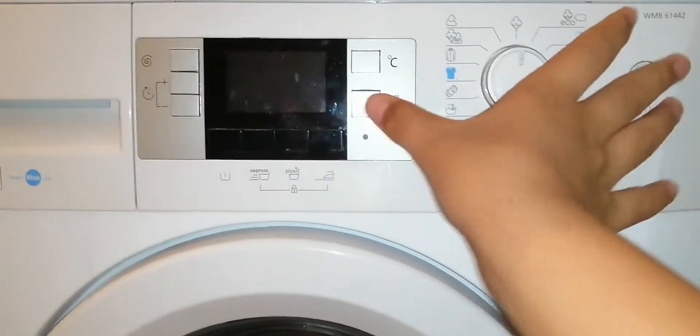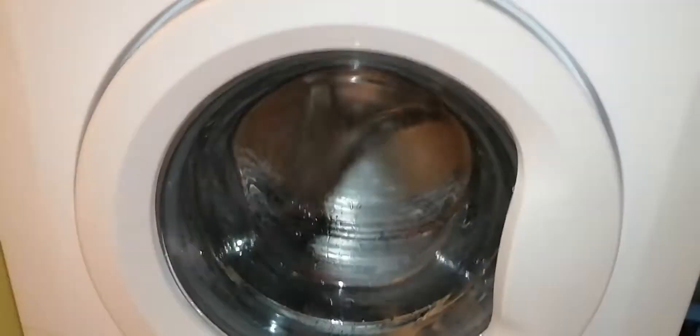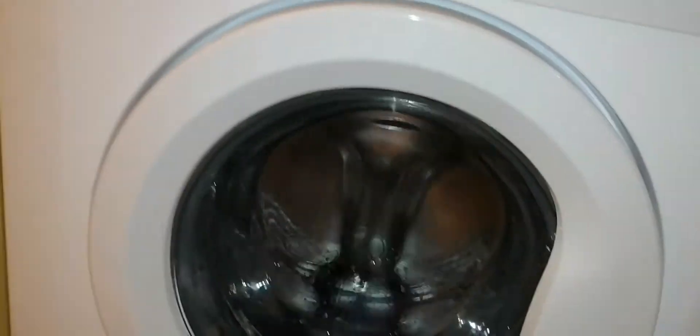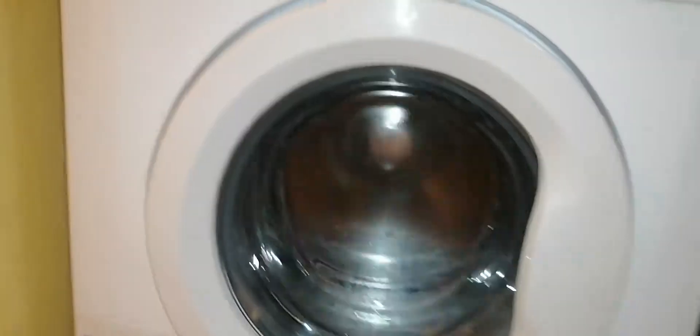That's the inner top level — you don't want to reset the program. It will reset automatically when you put it back into the cotton cycle. Put it into the cotton cycle again: one tumble to the right side, then the left side. You should let it make at least one complete tumble before putting it to spin, otherwise the machine will just drain instead of spinning.